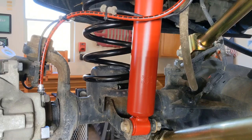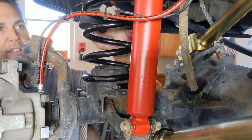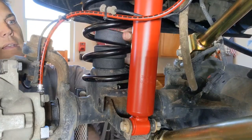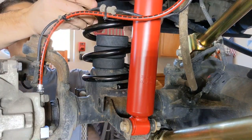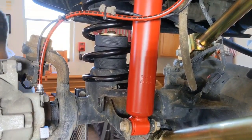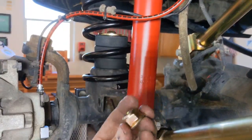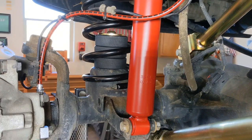Let's get the bump stop extensions in. The instructions tell you to have them already put together when you're putting the spring in, but they always get in the way. I just take them and put the pucks in one at a time, then fish the bolt and top plate down through to the bottom. You can raise up and see where the hole is, then put on the nylock nut on the bottom side and use an Allen wrench on the top side. Tighten it up — snug but don't over-tighten to where you'll cause the pucks to prematurely fail.